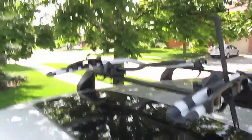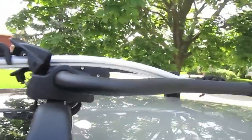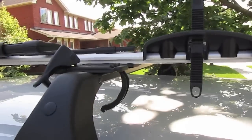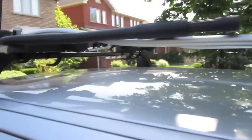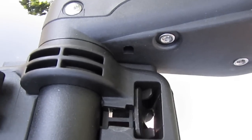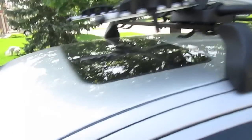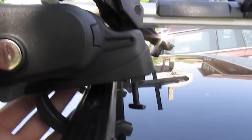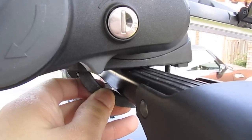Now this is the continuation with the bike racks. I've already gone ahead and put it on beforehand just to make sure it worked and that I wouldn't potentially destroy my car. I couldn't get it on the first time — you see these pins? What you have to do is start with these U-clamps right here — you thread them through that hole before you put it on top. If you don't, it won't fit across. If you try to thread them while it's on top, you'll hit this bar, and I pretty much gouged that side trying to do it.